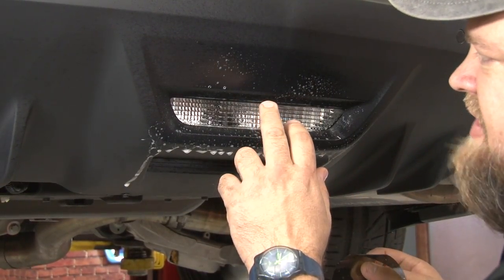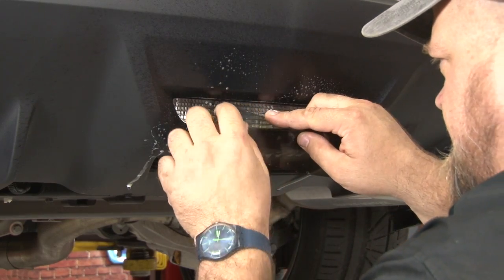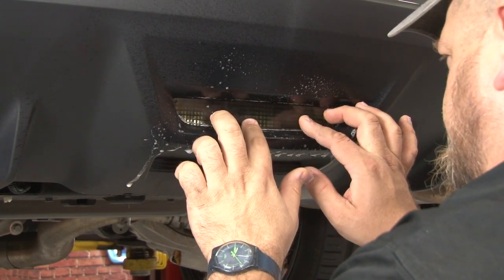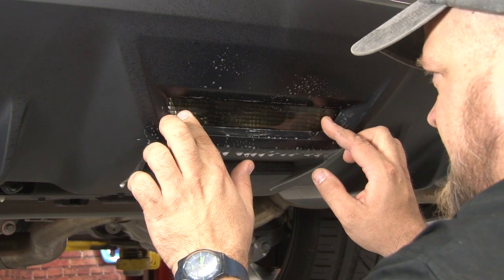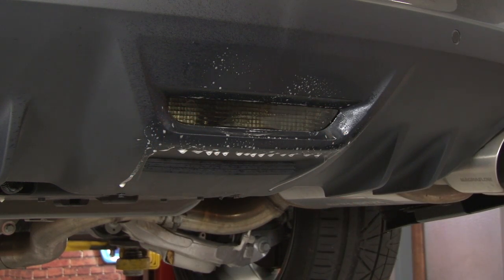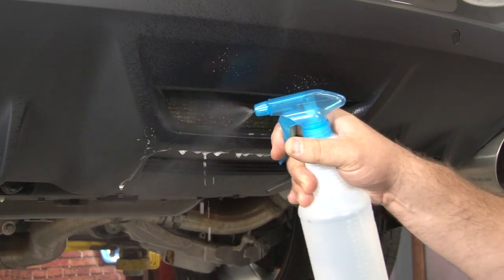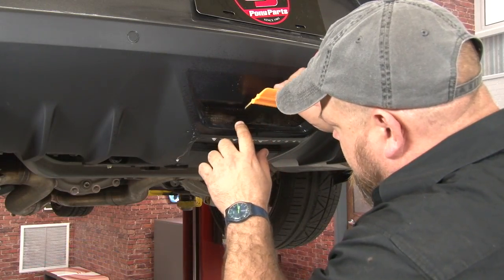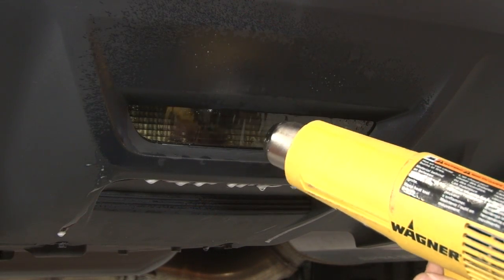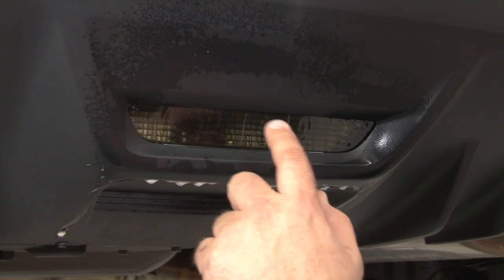Normally this one's pretty easy to do, but with the Roush Revalance, more of the backup light is covered up than normal, so you'll have to push the tint up inside. The nice thing is the valance will actually help hold it in place. Once you get it centered, spray it with some water to get rid of the application fluid. Use the squeegee to make sure it's flat, then use the heat gun — start in the middle and work your way outward. You'll get a bunch of little bumps on the edges, also known as fingers, and we'll smooth those out.